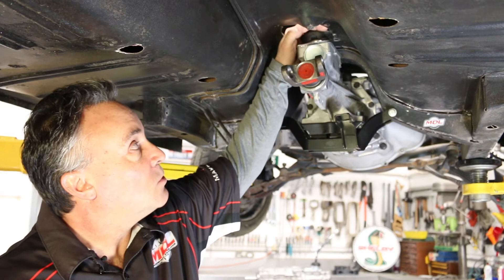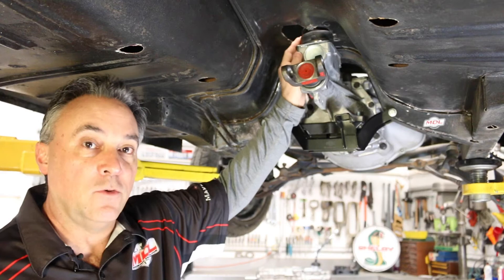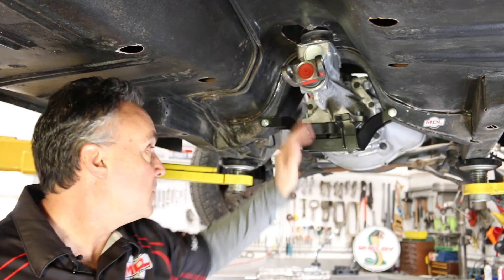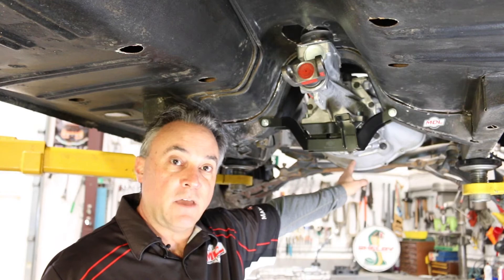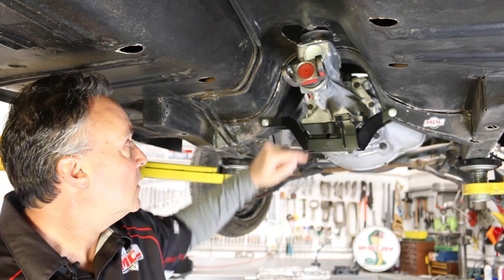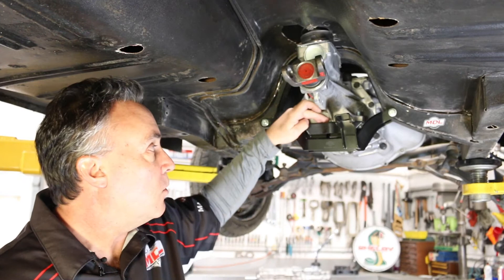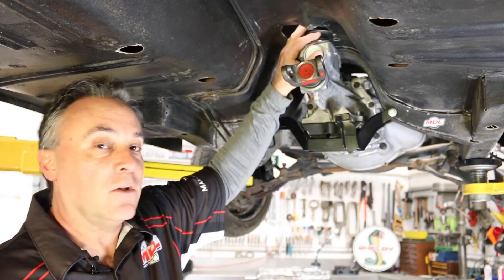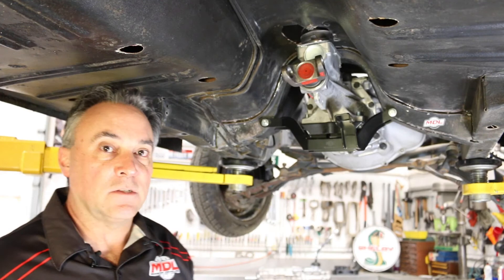You may notice where my fingertip is — it hugs the right side of the tunnel opening, which is considered normal. Big block cars in 67 and later will have this a little further back, but it'll still hug the right-hand side. Modern Driveline offers offset shifters to accommodate such things. Here we have installed a small block Ford T5 aluminum bell housing with the natural cant of the installation for the T5, allowing the crossmember mounting pad to sit flat. This makes installation easy — no angles or anything. For a standard six-bolt bell housing, we have adapters that also accommodate this slight angle needed to clear the tunnel opening.